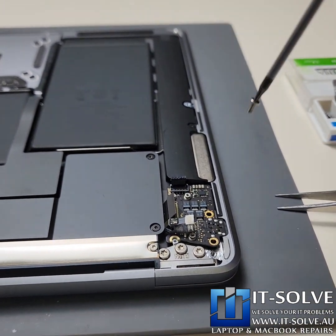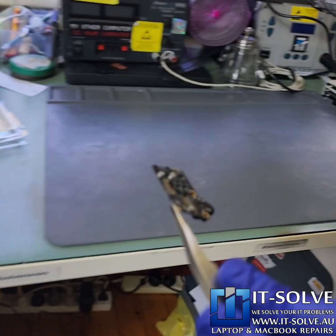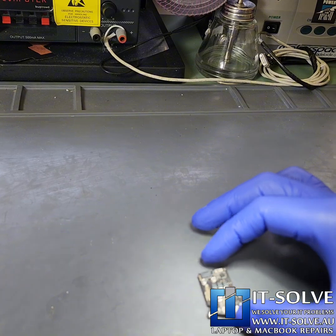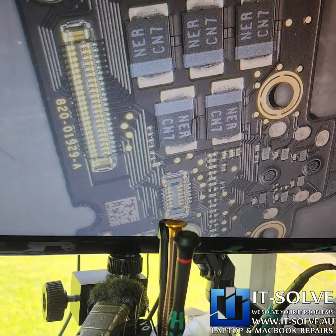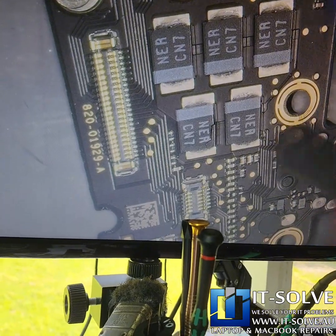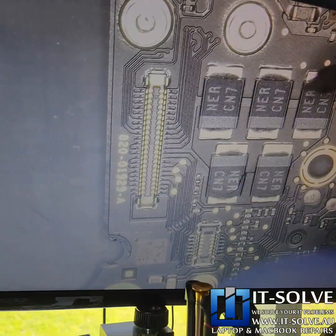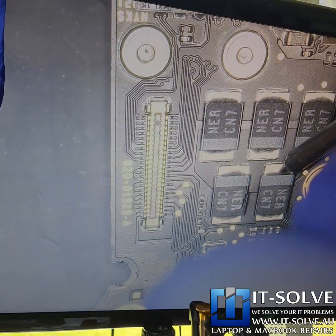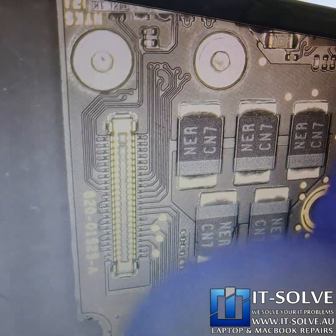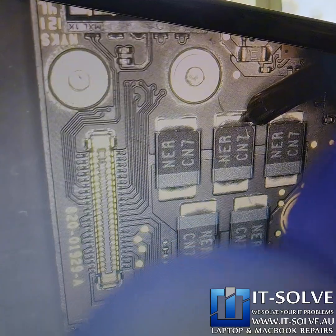Let's take it out and go into the microscope. We want to quickly measure one of the main voltage lines to see the internal resistance. These are voltage lines and these ones are filtering capacitors. We have a short circuit between the plus and minus of these filtering capacitors.